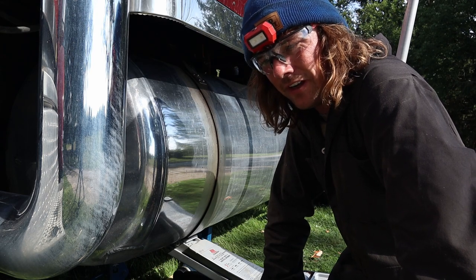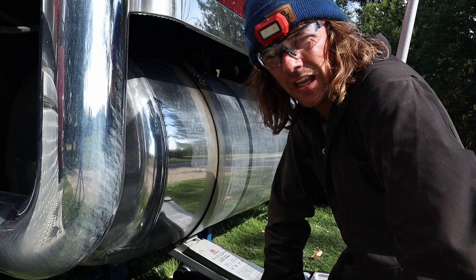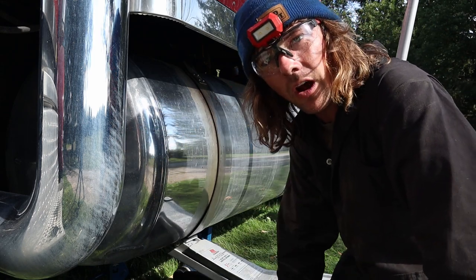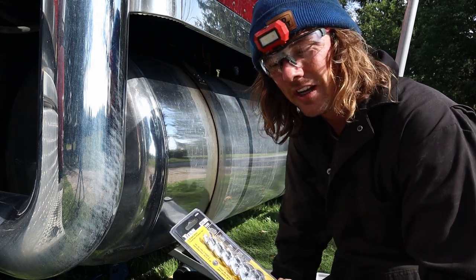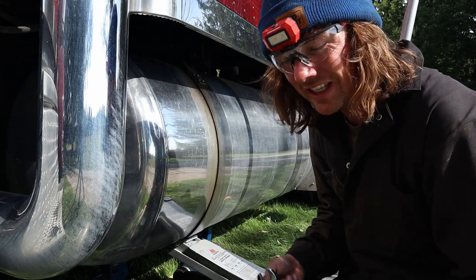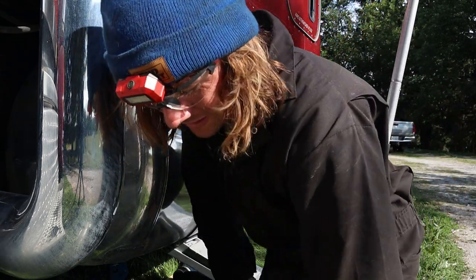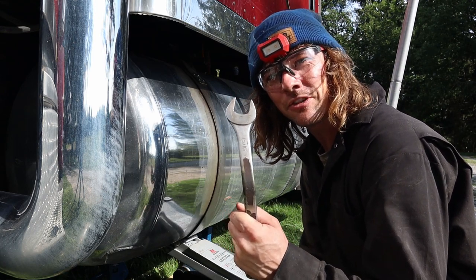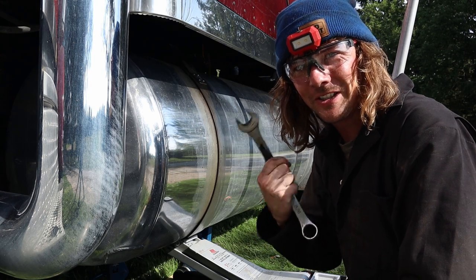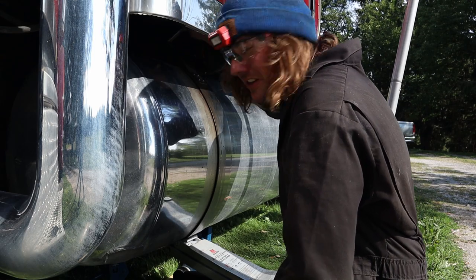I went to town and tried all the parts stores open on a Saturday. I couldn't find a 15/16th crow's foot wrench or a 15/16th ratchetable box wrench with a pivoting end. I did buy a set of crow's foot wrenches before and using those I determined it's between 1 inch and 7/8, so 15/16th — which doesn't come in the kit. But I stopped by the shop and found a 15/16th inch wrench with a homemade bend in it that looks like it was used specifically for this job before, so we're going to use this to take the tank strap off. It fits right on there.